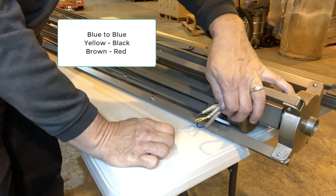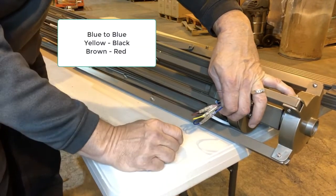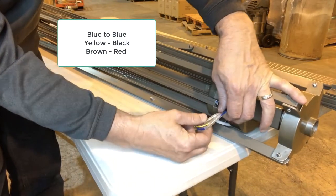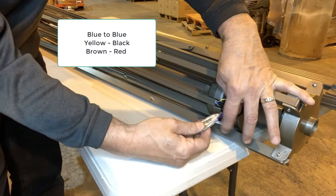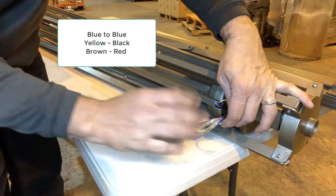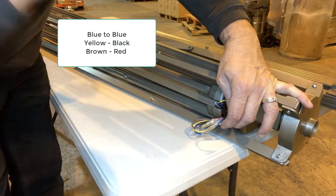It's a very simple wiring system in the umbrella. There's only three wires that run the umbrella. But a lot of times one of these at the top of the umbrella, underneath this small canopy, comes apart. Push them together, you put the umbrella back together, problem is solved.